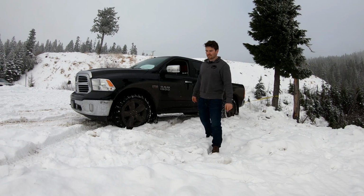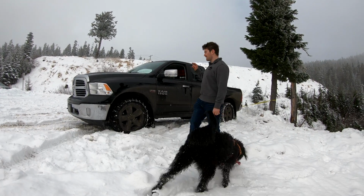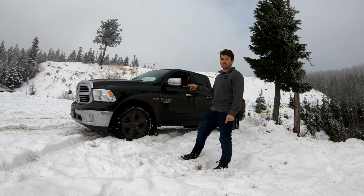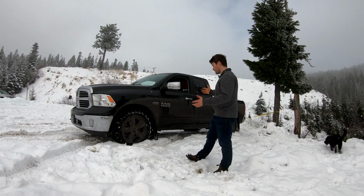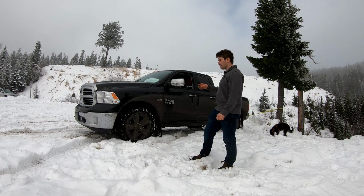All right, guys, four-wheel drive auto spins the front drive shaft, but we knew that that's not the problem. The problem is in four-wheel drive lock, is this front drive shaft always locked? We know it's not ever always going to be locked. That's just what the BW4444 transfer case does. But I just wanted to really show you guys that it does come on and off.